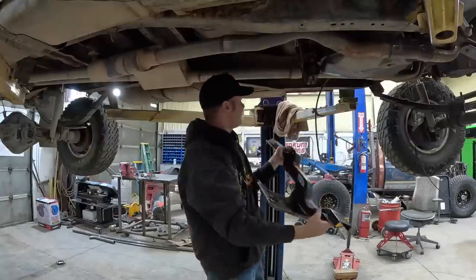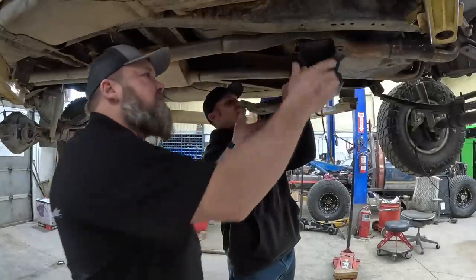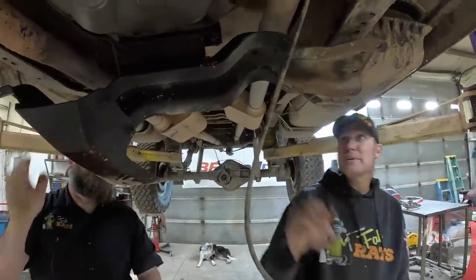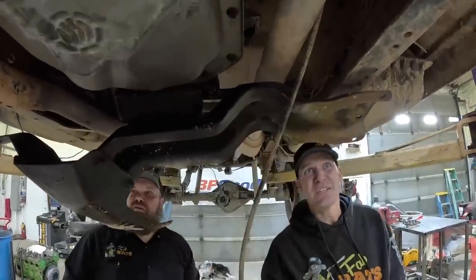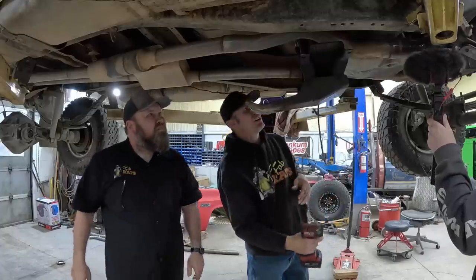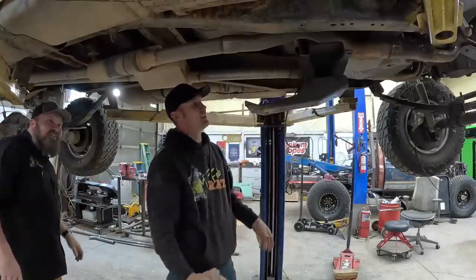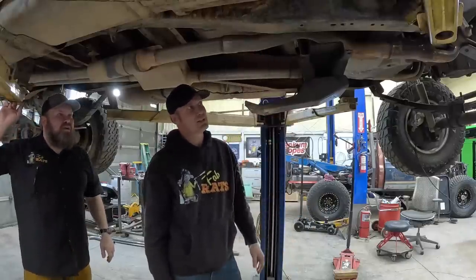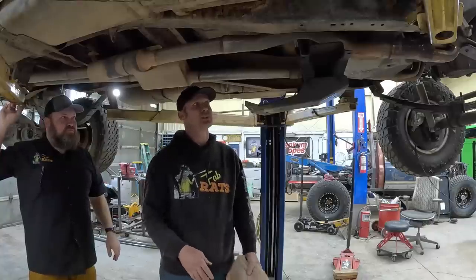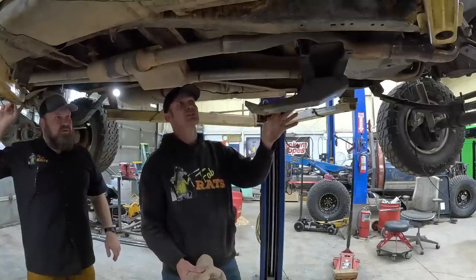Oh, the only thing I don't know is if that transfer case is the same spline count as that. We're about to find that out though. Huh. That's going to work. My exhaust is going to be a problem. Maybe not once the header's up and on. I guess we'll bolt this up, then we'll let down, get the exhaust bolted up to the heads. And see where it is, and then we can probably just cut it off, put a transfer case in it.